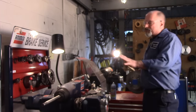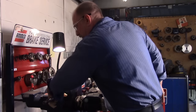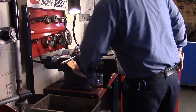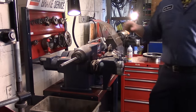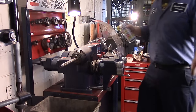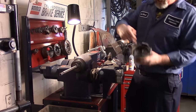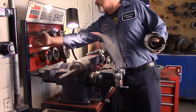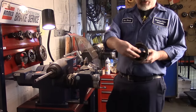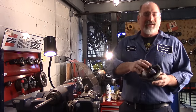We're going to take the rotor and mount it onto the lathe. First, we need to make sure there are no metal shavings on the back or on the arbor — we're cutting metal, so there will be metal flying around. I'm going to clean off the arbor and give it a quick shot of PB Blaster so the tooling slides on and off easily. I'll get my initial mounting flange. On the inside of the flange is a raised part for my spring, which keeps pressure on the centering cone — keeping the rotor centered on the lathe is obviously very important.